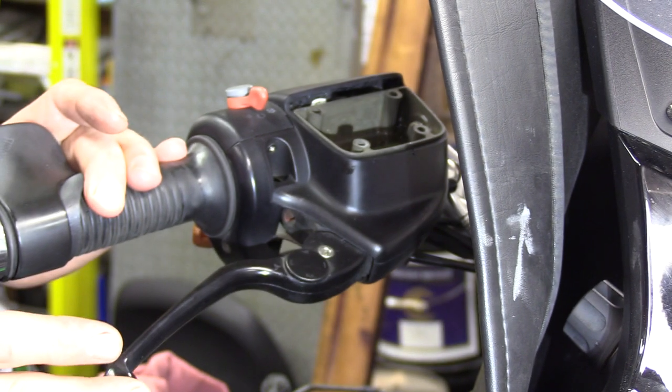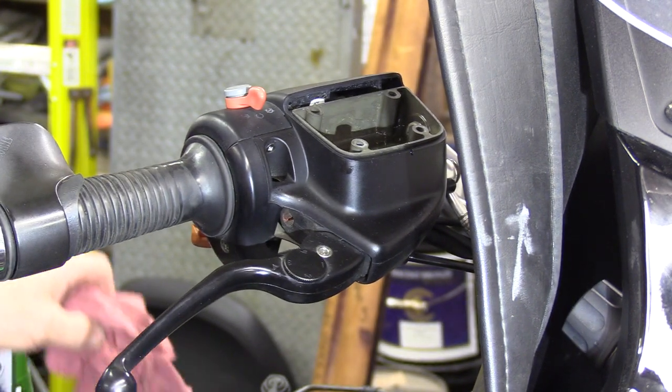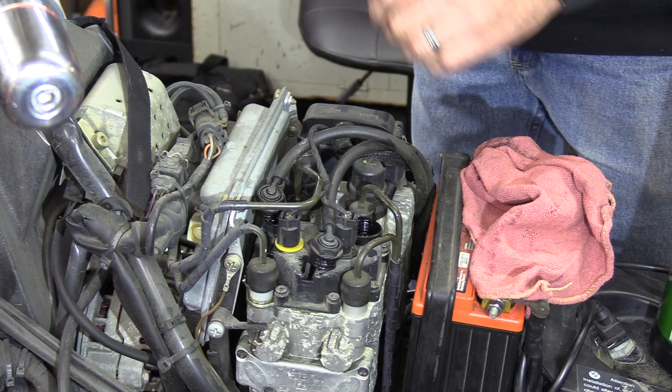It's also very important at this point to have some kind of protection so you don't splash anything onto your paint or windshield — as you're doing this the fluid inside can jump. If you squeeze too fast it will jump right out and now you've got ruined paint to deal with. This step is no joke — it takes a while. A lot of guys contact me saying they can't get the brakes to bleed, and this is almost always the issue.